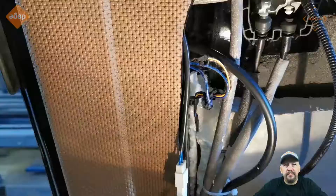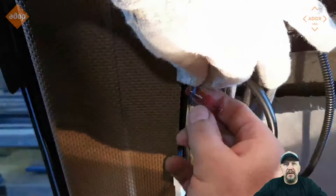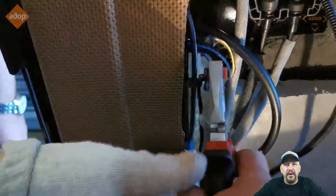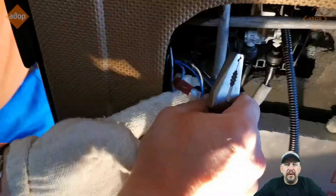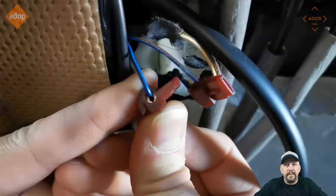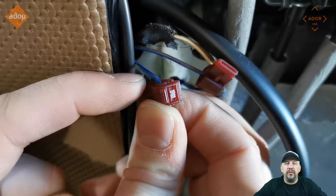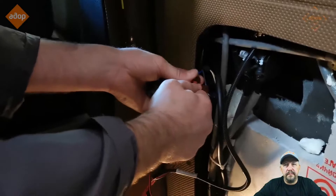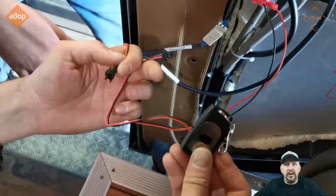There are two wires that go from the controllers on the side of the door — those are the wires that lock and unlock your system. You have to find those two wires; they are blue in color. Hardware is included to get access to these two wires. When it's connected, you'll be able to plug in your additional hardware — you don't have to cut anything, just get connected. Then connect the hardware; those two wires will lock and unlock your system.